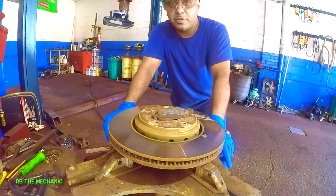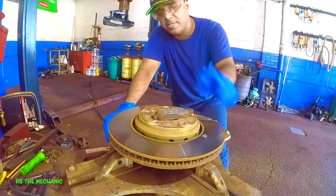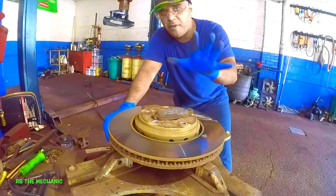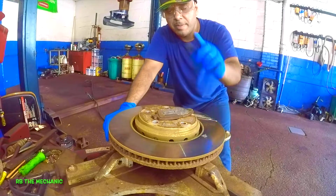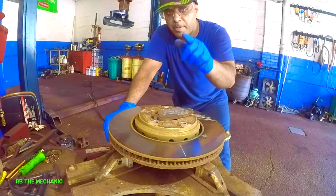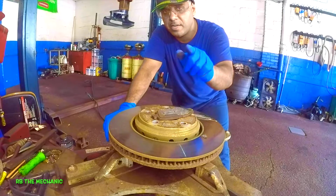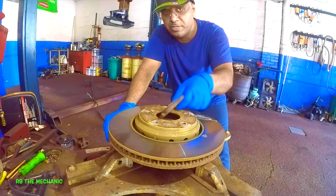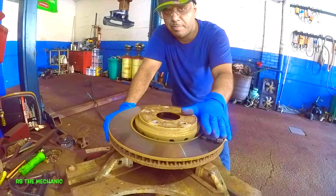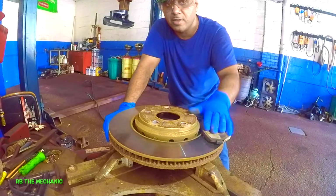I'm going to be reading you some instructions. You've probably seen a lot of my videos, but you've probably never seen me breaking the brakes in. I've done a lot of brake jobs, probably have over 500 videos on YouTube. But anyways, you're going to see me read instructions, and I'm going to post the instructions online. It's easy to break the brakes in on every brake job, but you do need to replace the brake pads and the rotors together. You can't just change the brake pads and try to break the brake pads in. No, they need to meet each other, okay?